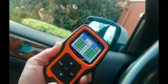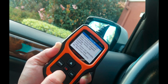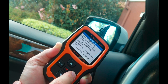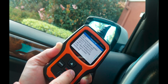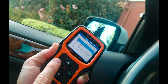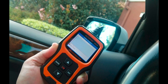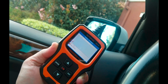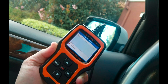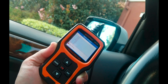After you do a system check, you can see right here it shows you in color exactly what's going on. In the about section, it gives you specific details on each color and what to be concerned about. Once you get into the data stream menu, it gives you a list of items. I selected engine RPM, and once I select it, it'll start graphing it — as I accelerate it'll go up, then come right back down when you stop. It's handy; you're able to lock in and really help troubleshoot specific items with your vehicle.